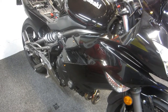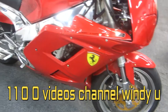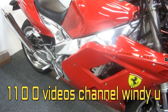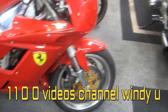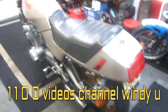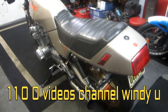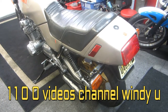It's always good to check each one. A very convenient rule of thumb: any time you have the wheels off the bike, it's very convenient to look and see what the brake caliper wear is. I just put a set of Michelins on this bike and noticed the back pads were ready for replacement, and one side of the front pads is getting ready too. So I thought, it's the beginning of summer - I just got a whole new set of pads.